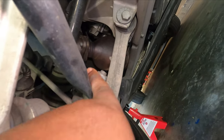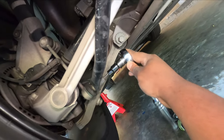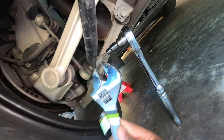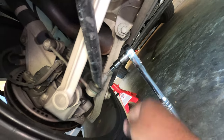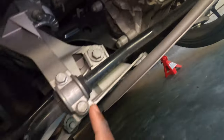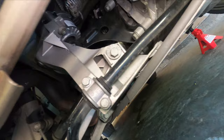You put a T30 right here like this, and because I don't have a 16mm wrench I'm using this tool right here, so you can put it like that and just start spinning. That's what I'm going to do to remove the sway bar bolt on this end and on that end. And then for this one, you simply use a 30mm and that's out.